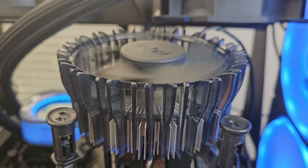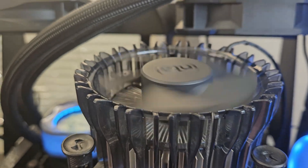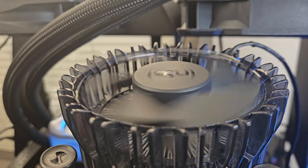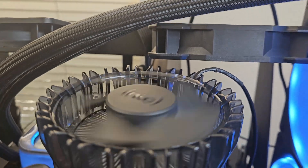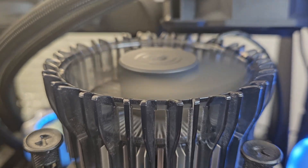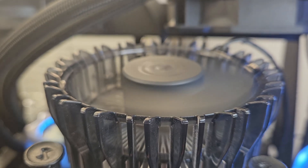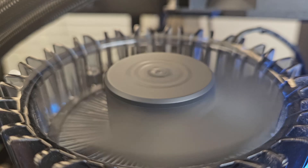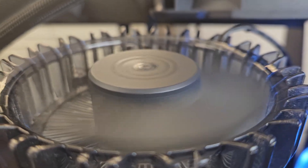That being said, the stock cooler was insanely loud. I didn't even bother whipping out my decibel meter because showing you numbers wouldn't do it justice, so here's what the stock Intel cooler sounds like at full blast. At its lowest fan speed — about 620 RPM — it's nearly silent, but cranking it up to 60%, then 80%, then 100% reveals a high-pitched whine. It's not a loud roar per se, but it is pretty high-pitched and definitely audible.